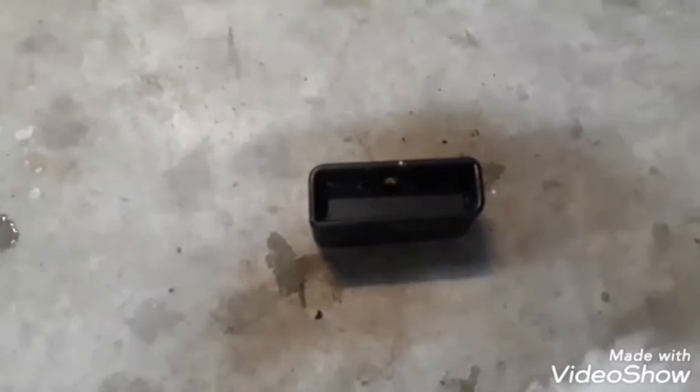I'll be waiting for the 3-inch block. As you can see, this block is wedged — on the right side it's lower than the left. You always want to put the smaller end wedged in toward the front of the truck, and the higher end to the rear.